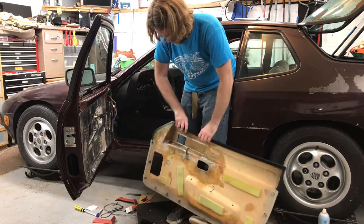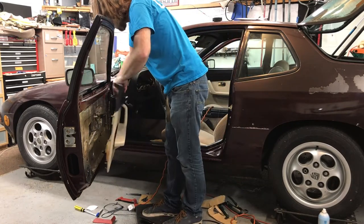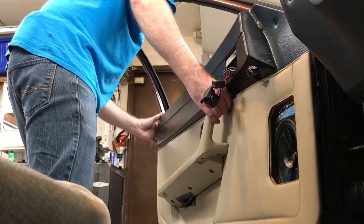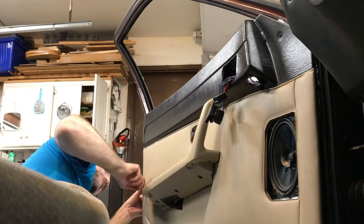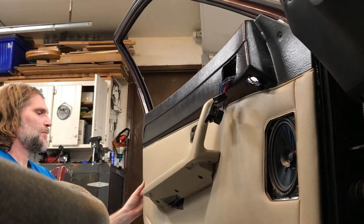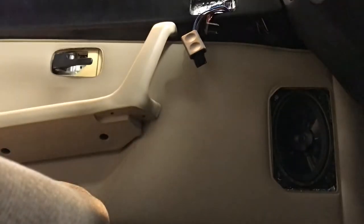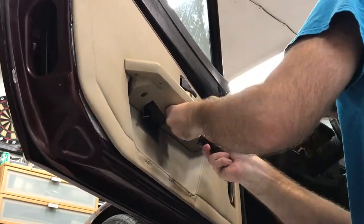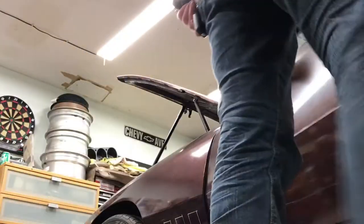Here I'm putting the rubber felt-covered seal on the inside of the panel — it just slips on. I used the stock one again. You've got to feed the wires through. Basically, when putting the door panel back on, make sure the piece bolted to the back of the panel goes into its slot on the door, watch that you're not catching it on the door lock rod, make sure your wires poke through correctly, then bolt or screw the handle to the door. I found it works best to start with the screw closest to the front of the door and work your way back.